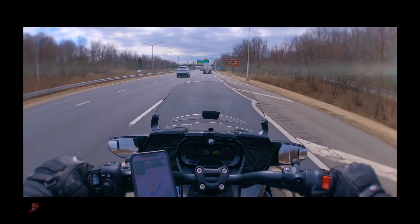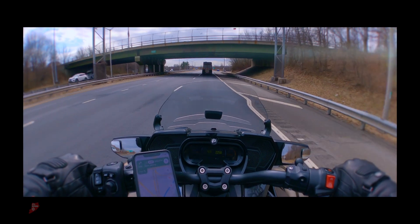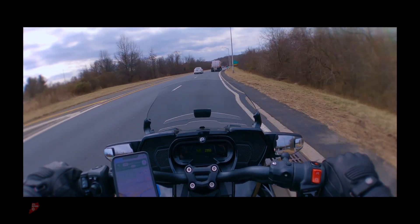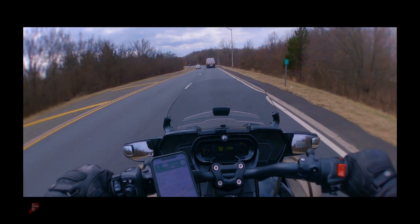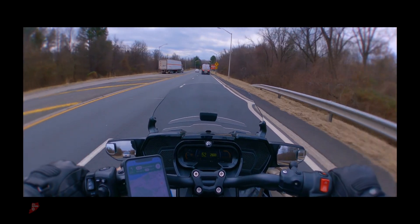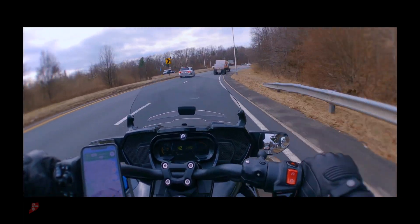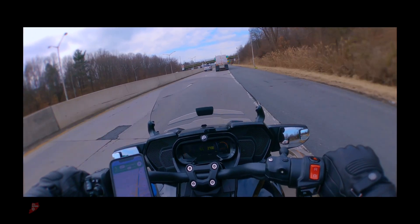With any luck, they'll put on the LED headlights. And because this is an F3T, it doesn't have the driving lights — fog lights, whatever you want to call them. It's got the blackouts for it and the wiring, but it just doesn't have the switch. The kit I got from Sling Mods should just bolt into place instead of the factory one, because the factory one is like $400 and something dollars. This one hooks up to the driving lights so they'll be running when the bike's on, and it'll switch into a high beam when you hit the button.